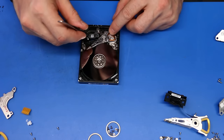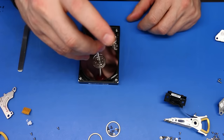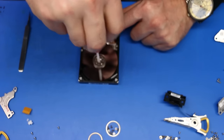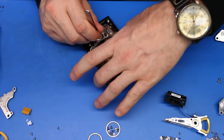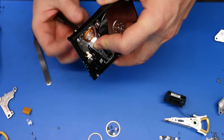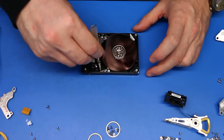Because we don't know the condition of the heads below the top one — and there are ten of them in total — we prefer to remove the parking ramp completely. If one of those heads is twisted and it's not going to line up with the parking ramp, the head assembly will just get mashed up completely. Removing the parking ramp means the heads are free to slide right off the disk surface. Heads are replaceable; the surface is not, and damaging the surface further may make data recovery impossible.